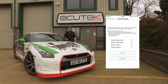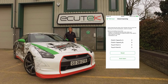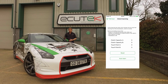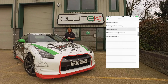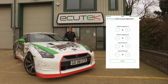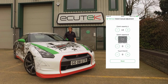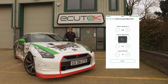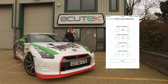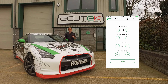Clutch learning is very important — it provides the touch points and clutch capacity. You can see the clutch capacity shown there. We have the ability to reset the clutch capacity and touch points, then carry out a gearbox auto-learn sequence, which takes a few minutes while the ECU calibrates the gearbox. Manual clutch adjustments allow the driver to adjust clutch settings live. We've got clutch capacity A and B and a touch point for A and B. The touch point is the bite point where the clutch engages, and the capacity controls how aggressive the clutch is when it comes in. A negative value makes the clutch slip for a very smooth takeoff, whereas a positive value gives a very binary, on-off race car feel. You can reset and go back to standard.